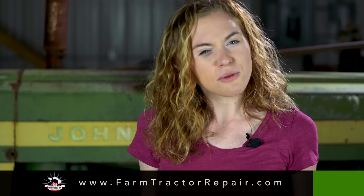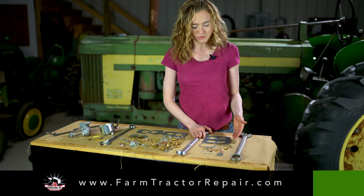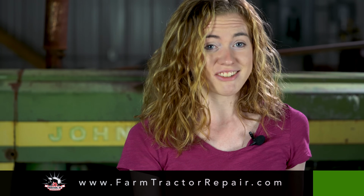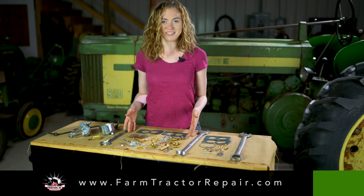When you are ready to rebuild your carburetor, you're going to need some parts. Let me roll through the options that are available to you so that they really make sense. The first option is a really affordable kit here. This is the economy kit, which comes with new gaskets, a needle and seat. There's times when that's all your carburetor needs, but there's also times when your carburetor does need a complete rebuild like we're showing you how to do on this video.